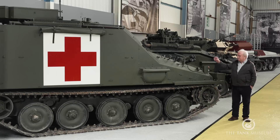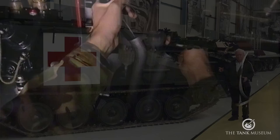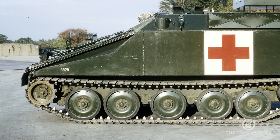The driver sits over there underneath a lid which pops up when he feels safe. He's got three pedals, one of which is the gear change — it's quite an odd arrangement, very much like the gear change you find in Chieftain. You change gear with your foot. You've got a choice of seven speeds, which means the gears are very close together — what they call the hot shift arrangement. The seven gears work in both directions, forwards and backwards at roughly the same speed, and the drive arrangements run to the front, ending in the drive sprocket down there, which is unusual on a British vehicle at this time.